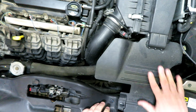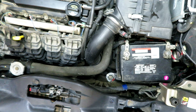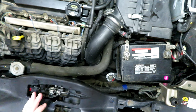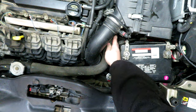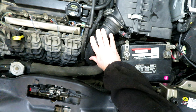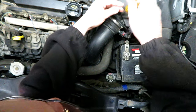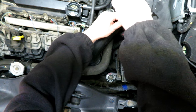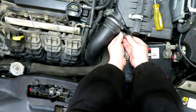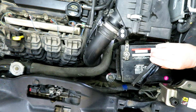So we're going to take off this air intake plenum and set that aside. I've already taken off the top plastic cover of the motor. The block heater is down in behind this air intake hose, and there's also a radiator hose sitting there too. I'm going to take this air hose off to get better access to the heater down there. Be careful of the air temperature sensor wire — set that aside and pull the hose back.